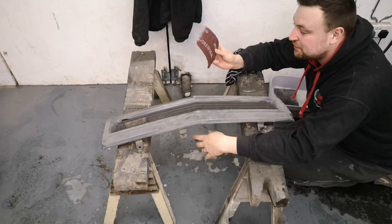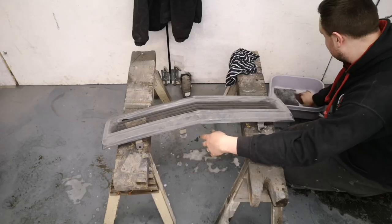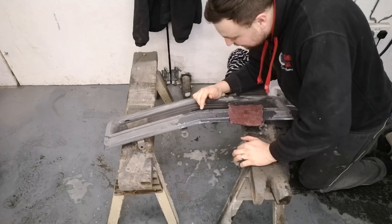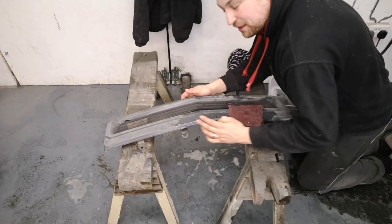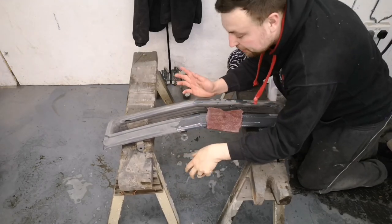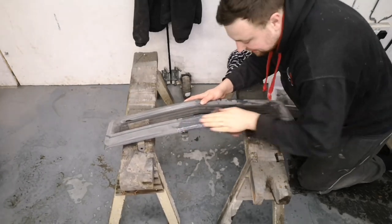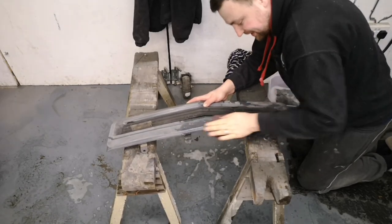Now because this is so bad in places I'm going to start with the red Scotchbrite because it's a little bit more abrasive — it will scratch it more, but I'll finish it with the black. Looking at this, you can see it's been painted once, twice, maybe five times. There are various different coats. It looks like it was originally black — I think it was originally a GTE. GTEs were colour coded as standard, SRs were just plain plastic. But this was an originally painted one from the factory, which is better for me because it's easy to prep. The red Scotchbrite is making light work of the paint — it's coming off easily.